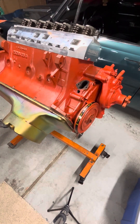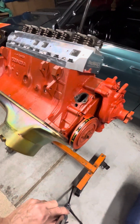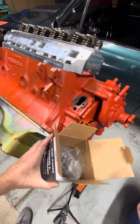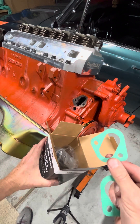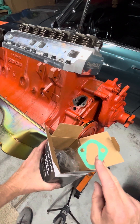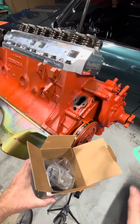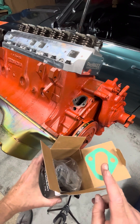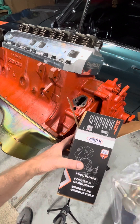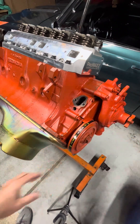All right, let's roll it around so it's easier to work on. So what do we have? It comes with a couple of gaskets - the holes are really small. Check your bolts, check your gaskets, but you might have to open the holes up a little bit. I took an X-Acto and just took a little bit off so that the bolts fit better, otherwise you're going to be fighting it and won't be able to put it together without the bolt tearing the gasket. Go ahead and trial fit your bolts first. I'm using this Carter pump, number M4845.